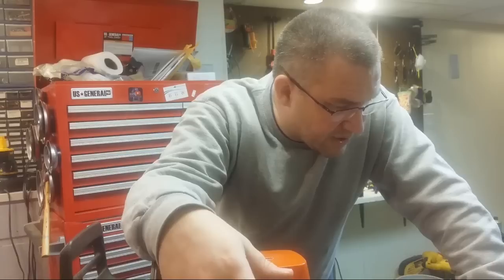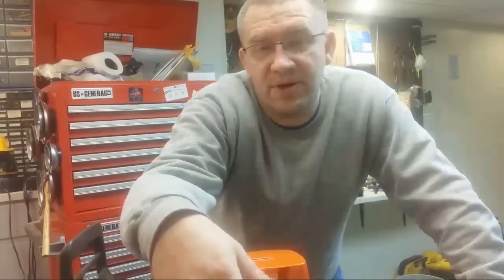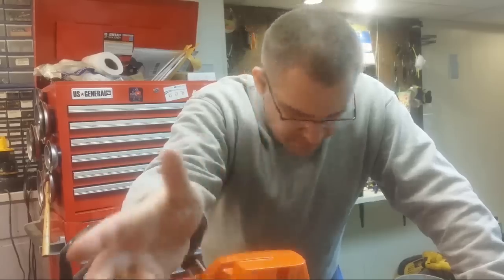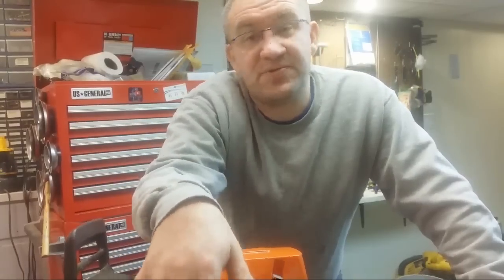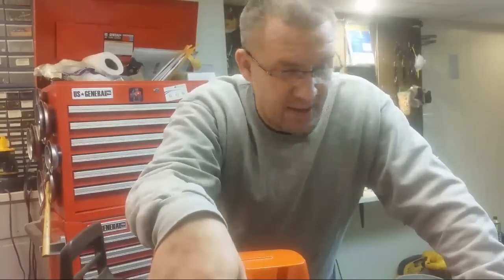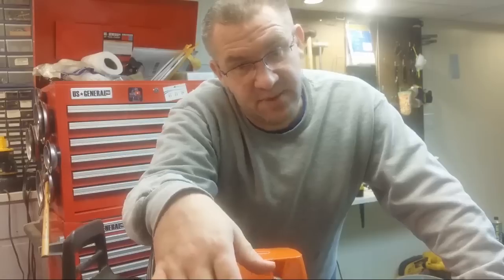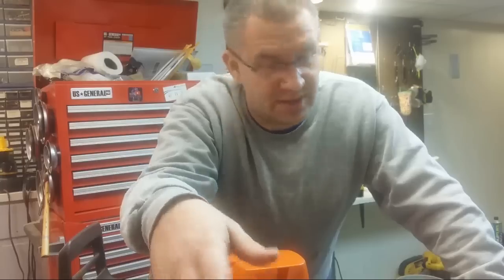Joseph Shaker, just real quick. I have a 350 you want to big bore at Highway or other. The simplest way, Joseph, is to get the OEM 346 XP top end, the 44.3 millimeter one. You can get the OEM top end from HL Supply. It's like $110. The Highway top end, which is 45 millimeter, for 346 XP replacement, is good too. It's kind of up to you what you want to do. If the money's the same, you probably want to get the OEM. If the money's a little better on the Highway, then it depends on what you want to do with it.